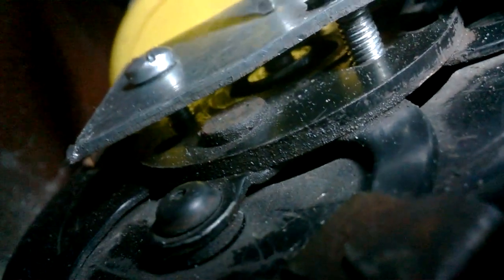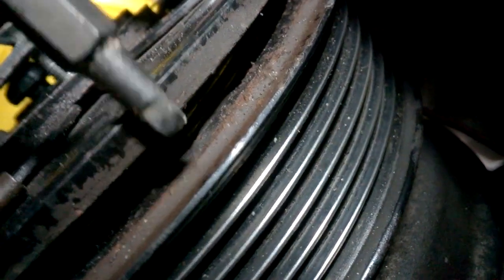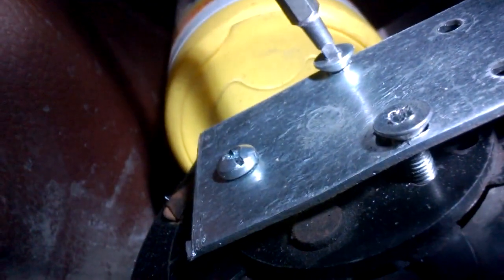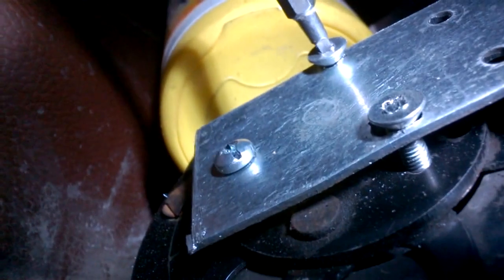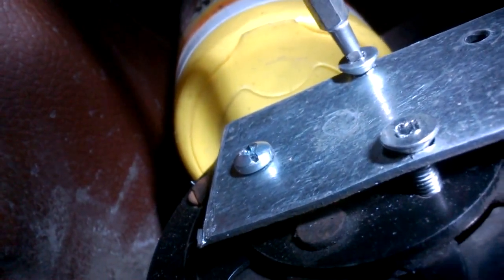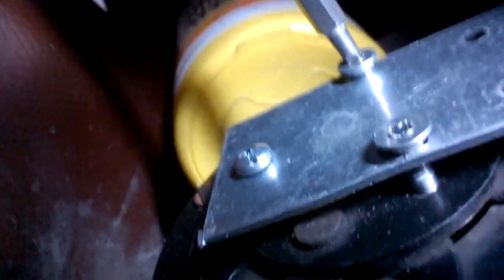As you can see I'm pretty advanced — there's already a good gap. This gap from the clutch means the clutch is coming out already. Turn it a little bit at the screws and you will hear the popping sound when the pulley is moving out.